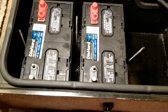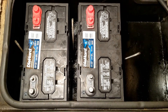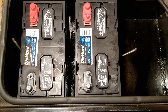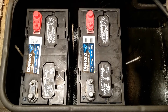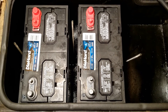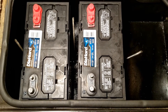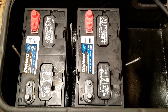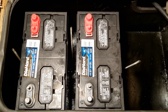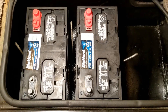We got these batteries set down in here. They're Group 29s - that's about as big of batteries you're going to get in this compartment of these Winnebagos. I believe it's 230 amp hours, which would be more than enough. The other ones that were in here were a little smaller and we never had any issues with them - probably 8 to 10 years. That's about as big a battery you're going to want to get in here.